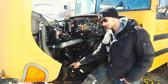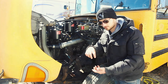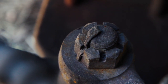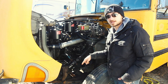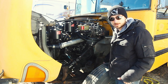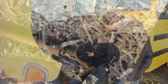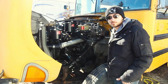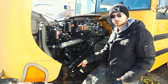Other components to look at in the steering system include anything connected to it. A lot of them have a cotter-style pin — there's a nut with a hole through the bolt, you slide the pin in and bend it around so the nut can't become loose. Make sure if there's supposed to be a pin in there, it's there. Also check the tie rod end that runs all the way across connecting your two wheels — make sure all pins associated with that are in place as well.